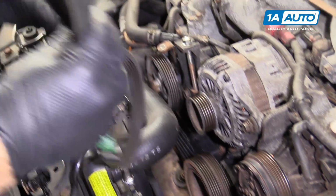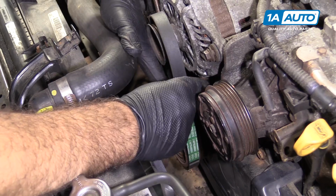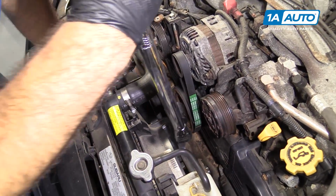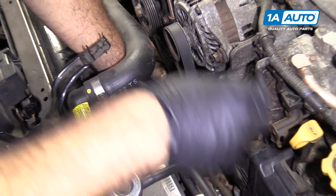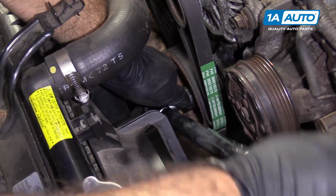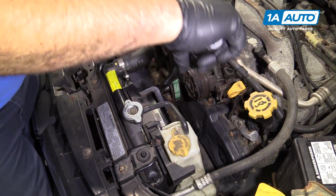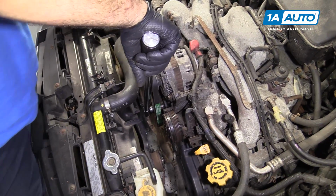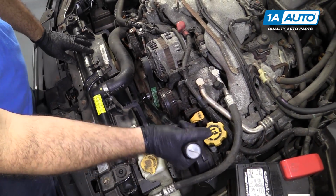We're going to use the alternator belt that we already ruined. And we're going to put this on here in the opposite direction of the way we used it to take it off. Set the initial torque at 33 foot-pounds. Clicks, you're all set. Use our larger torque wrench, and we're going to torque this to 133 foot-pounds now. Once it clicks, you're all set.